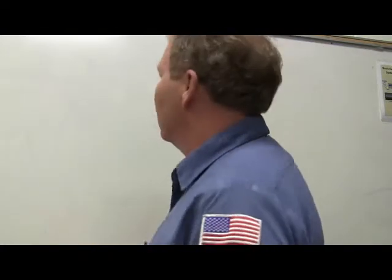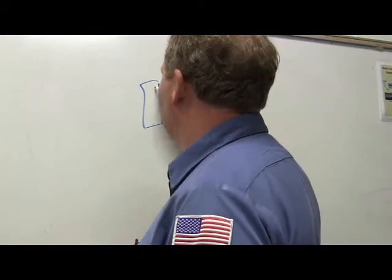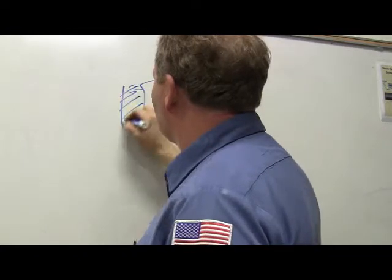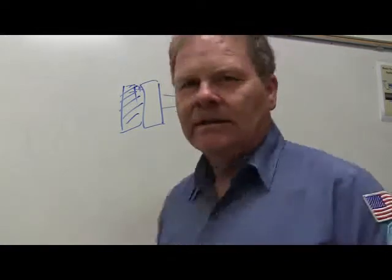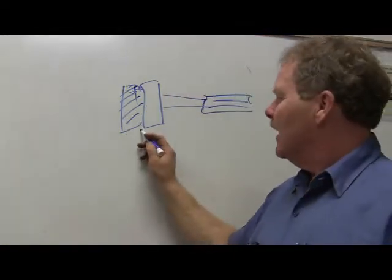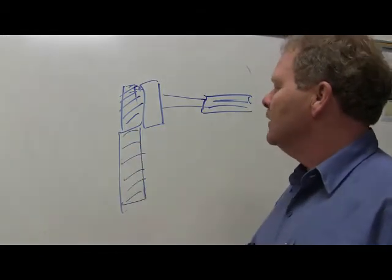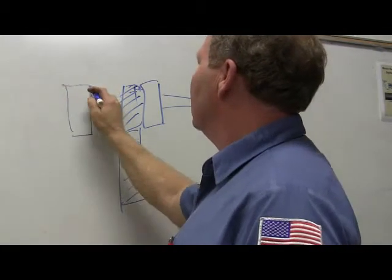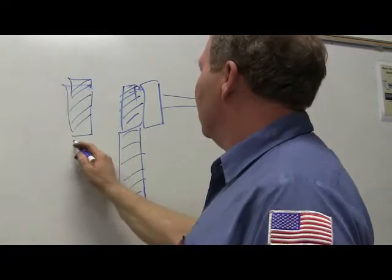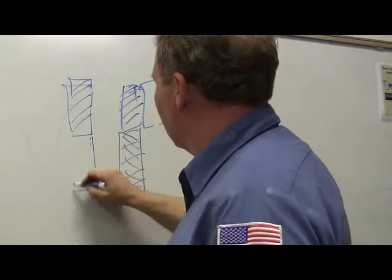The same, put a smaller gear in between them. Well, yes and no. It doesn't have to be a smaller gear. But what did we do on our transmission? We have power coming in from the engine. Remember this? You have a bearing here, and a helical cut gear right on the end of that shaft. And of course, here's where your clutch splines on. Down here, you have a gear that's big and it sort of matches that one. Back here, you have a gear that's slightly bigger in diameter. And down here, another one that's slightly smaller than the one in front of it.